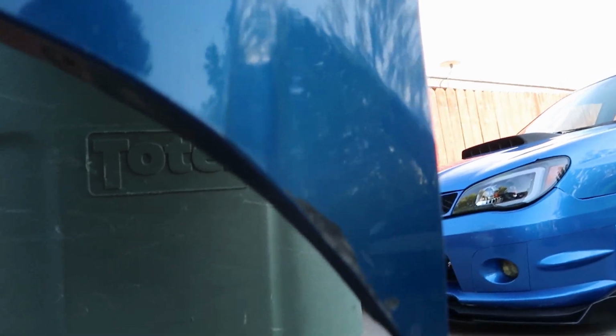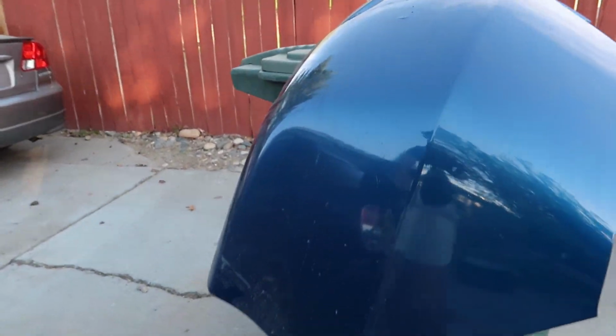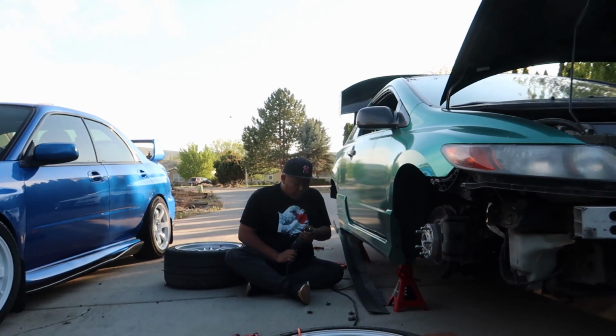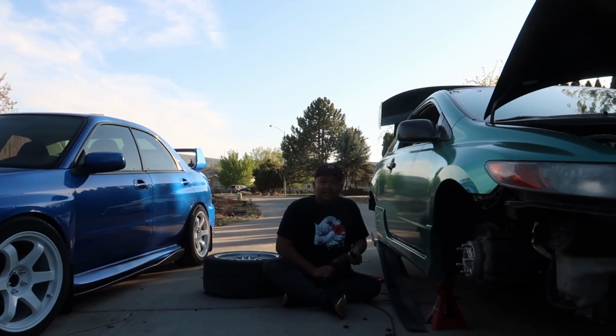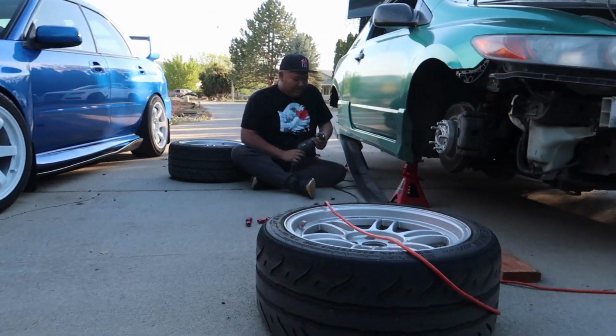So right here is where we need a bondo and sand. Now, this step probably isn't necessary, but I'm gonna still clean it off with some alcohol. That way the bondo binds a little bit easier. Technically it should be fine, but that's what I'm gonna do. While Tommy finishes that up. Do that. I have no say in that. I don't know what I'm doing with it.